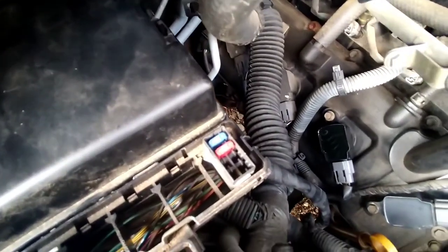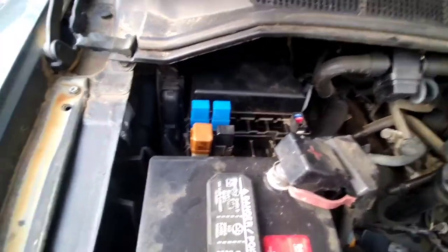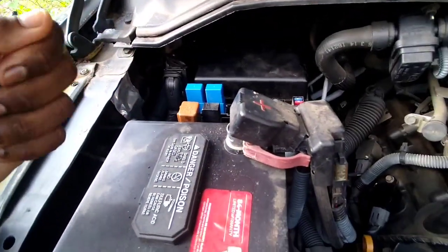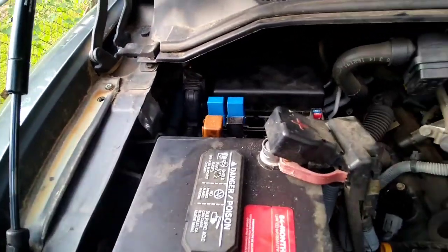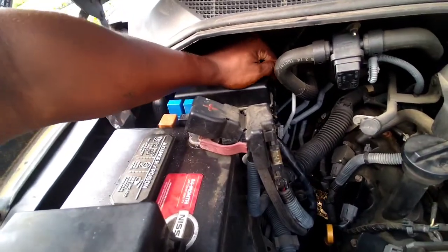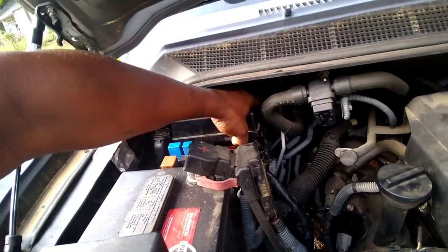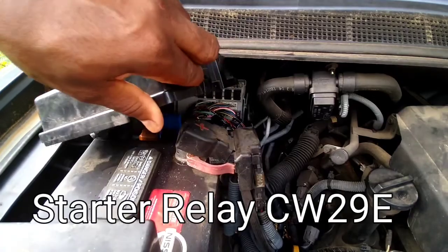You need a 15 and a 10 — all of this is for your tow package. Now I had a problem with my ignition switch as well. What ended up happening is when I try to start my car I can hear it click from the starter but it won't start sometimes, and I'm going to show you that because that's something people aren't telling anybody. Let me pull this out — this is another fuse panel back here.